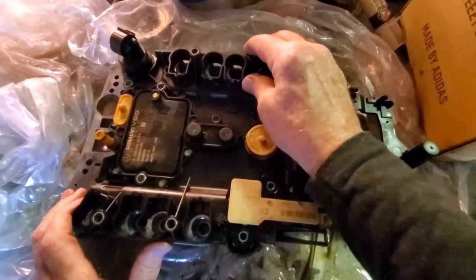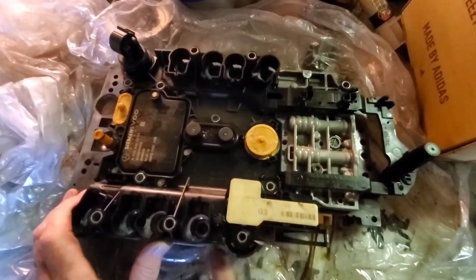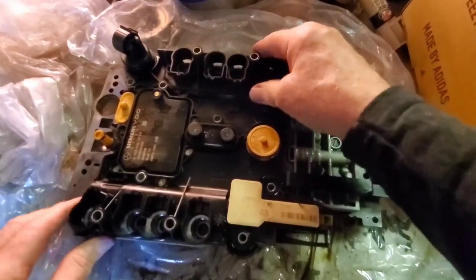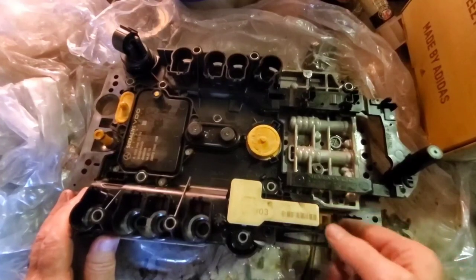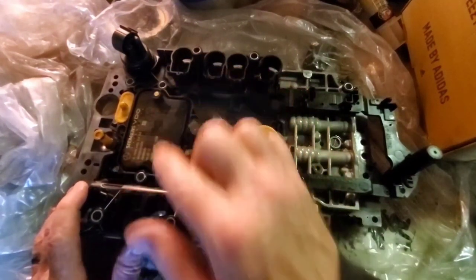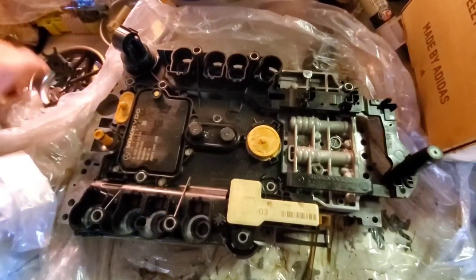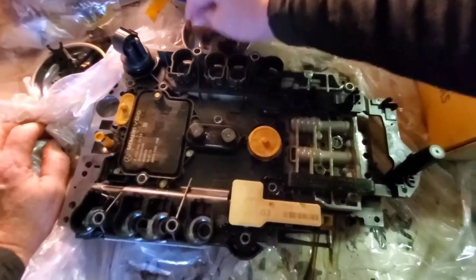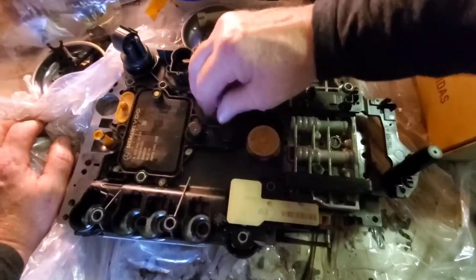I didn't go watch a video — I just fooled around with it a little. It seems like there was a plastic pin somewhere right around here that has to line up with a hole in the valve body, which allows the whole thing to slip down into place. It did, and then my little slide just slid right back inside. I assume these have to line up with something when it's going up into the transmission. Now I just need to reinstall all the fasteners — these hold down all the solenoids, and this bowl here has our conductor plate fasteners.